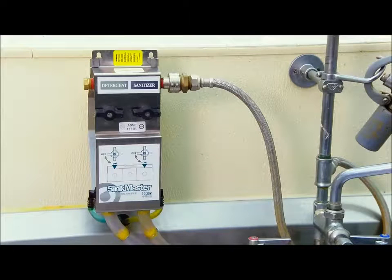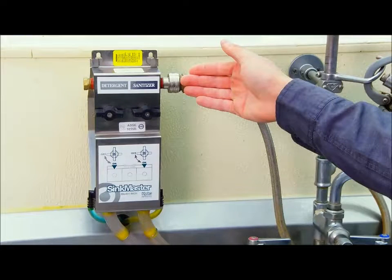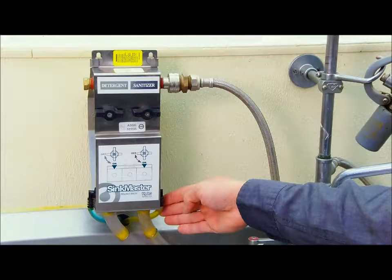This is a typical sink point dispenser, usually mounted on a wall over the sink near the center. The dispenser is fitted to connect to local water and automatically dilutes the Serve Clean HD and Serve Clean Sanitize correctly for use. When installed, dilution control tips are inserted to assure consistent product performance. It has two pickup tubes to connect the Dish HD and sanitizer to the unit.